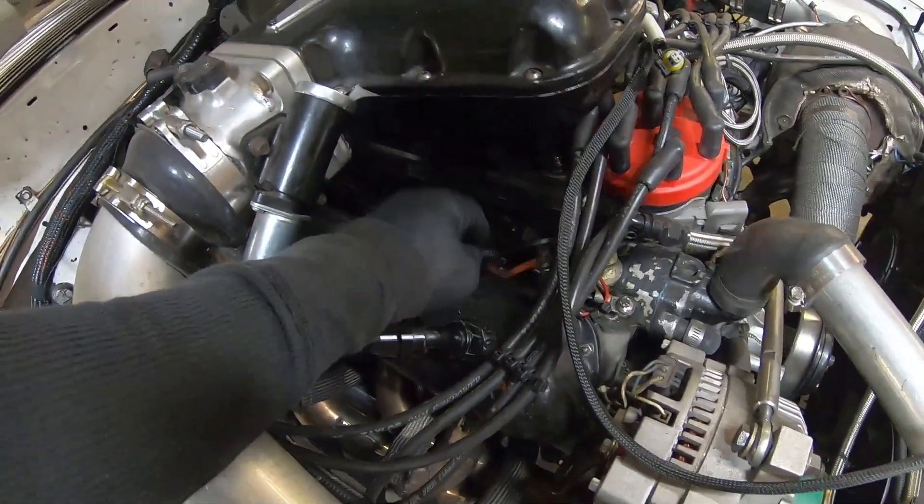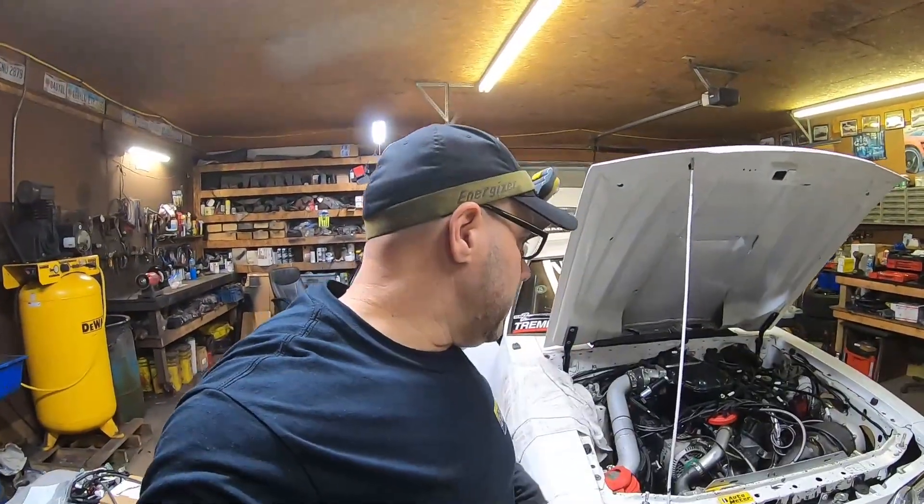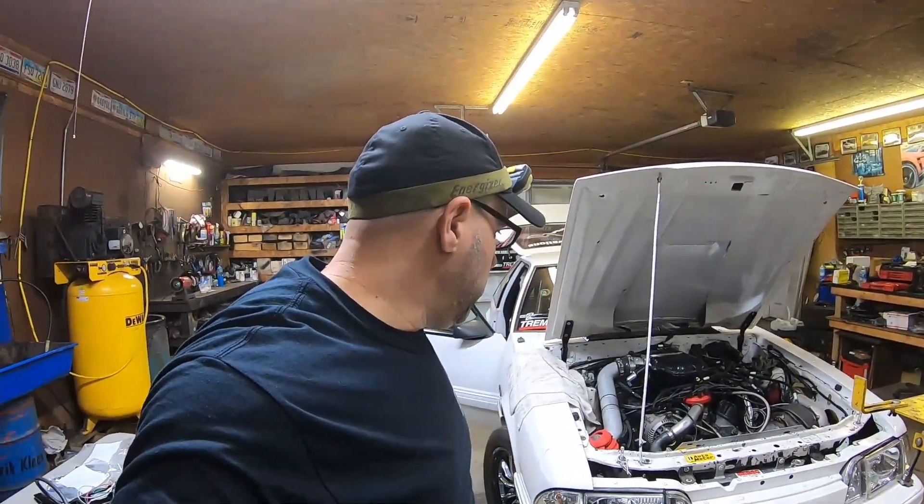I know this is key-on for my electric fan setup. I've already got an aftermarket electric fan, and being this is a Terminator X, I won't have to use one of my input/outputs for it. On the Holley Terminator X you only get four input/outputs and an electric fan is one of them. I've been running a Ron Francis fan controller on a Contour fan for years, so we're just going to continue to use that and save an input/output.